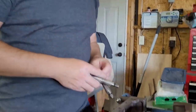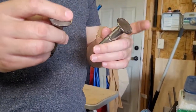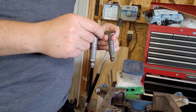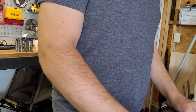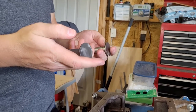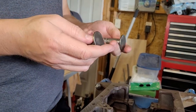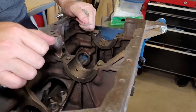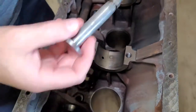On this motor in particular, the first thing you want to do is make sure that you have your tappets installed. The tappets are what ride on the cam — this is the follower — and these are ultimately going to lift your valves up and down against the pressure of the springs. Ordinarily you would want to make sure that you put the tappets back in the bore that they came out of, but unfortunately we got this engine in pieces so we never knew which one they went into.